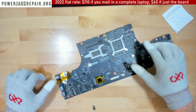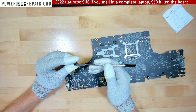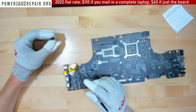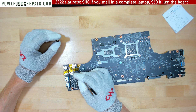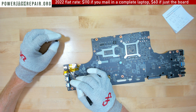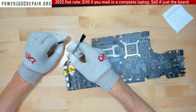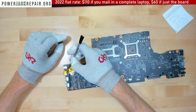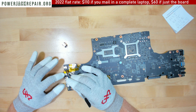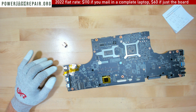There's some damage to the motherboard already. What happens with these connectors is that the rear pin connector breaks right where it meets the pin. What we're going to do is add some flux, then add some leaded-base solder. The leaded-base solder will mix with the flux and with the unleaded-base solder, dropping the melting temperature. Then we'll apply some hot air and use a soldering iron to press a little bit on each one of those points so it should come off. The goal is to find a heat point where the hot air isn't hot enough to melt anything around it, and use the soldering iron to drop those down.